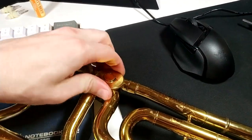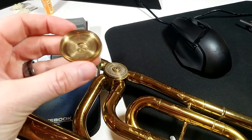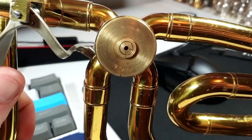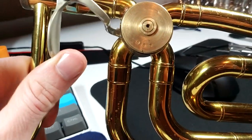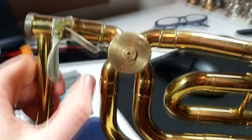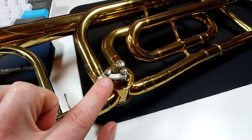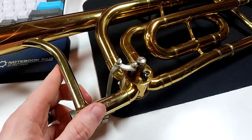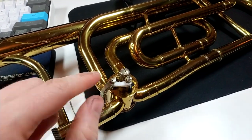First step, pretty simple: take off the valve cap. And if that's stuck, that's a whole other problem. Now that we have the valve cap off, you can check out the back where these witness marks on the valve should line up with the witness mark on the backing plate. Notice mine do not match up — but those are not always correct, and as long as it's actually 90 degrees, it's probably pretty close. And of course I don't have string linkage — I'm actually filming this at the end but I'll put it at the beginning. If you're confused about how the string linkage goes on, take a couple pictures from all angles to make sure you know how it works, so that when you get to the end you can just put it back together having a reference.